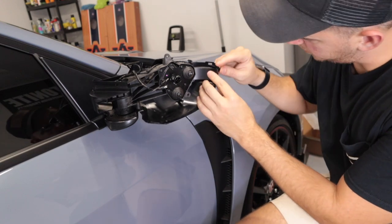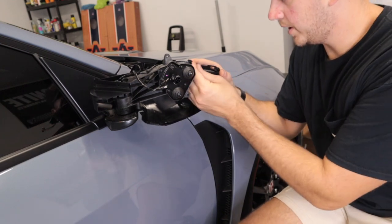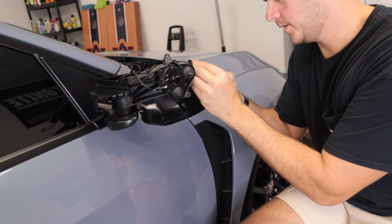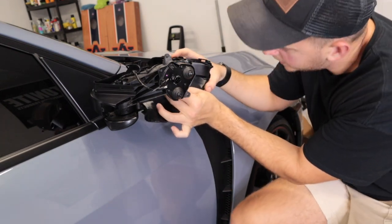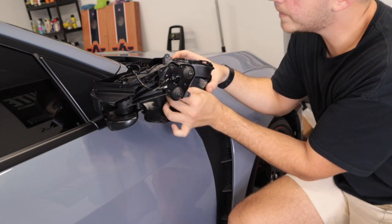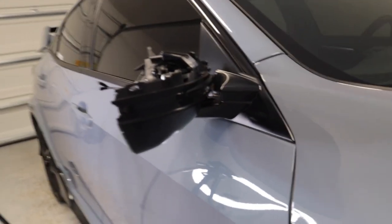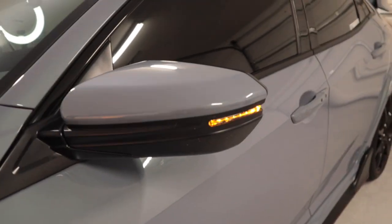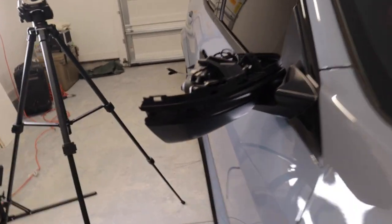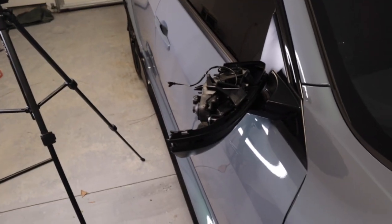Make sure you get everything lined back up. There are two little pieces of plastic right here that you need to sit in a guide, just like that. And then we're going to go ahead and get this one finger tight — we're just going to get it started. And then we'll zip it the rest of the way up. And don't forget the one back here. Alright, let's go ahead and get those secured. We got the new light powered up, and I did not know this, but it's sequential. That's awesome! So it's going to match the actual turn signals in the rear too. See, as you can see here — just a solid line — and then come over here and it's sequential. I love it. And it's smoked. So let's go ahead and get this mirror put back together, and then we'll snap the Sumo mirror on and see what it looks like.